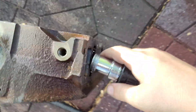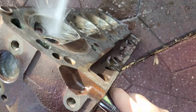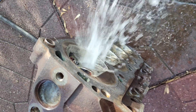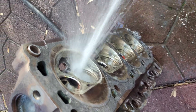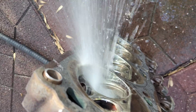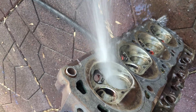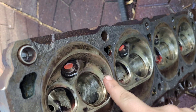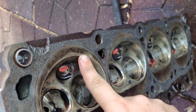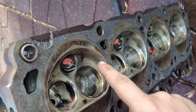Let's start with the intake. We'll just stick the hose in here. What do we notice? I'm moving it around, and the water — the fluid — always sticks to the roof of the port. It starts coming out right where we did all of our work. Right where we widened that out — that's exactly where the airflow is going. And that's exactly where we took chunks of metal out of our combustion chamber and laid this back.